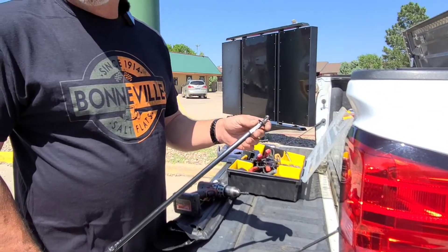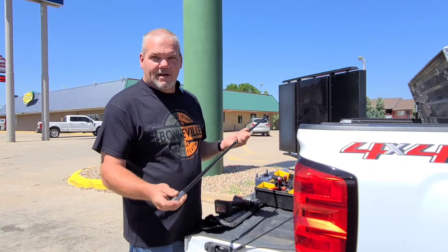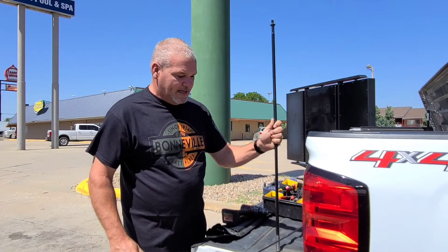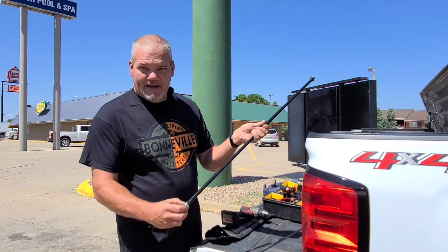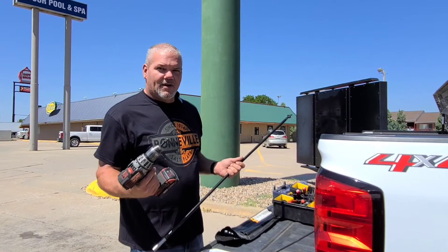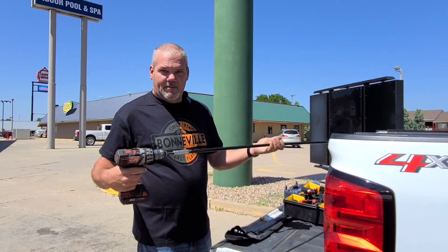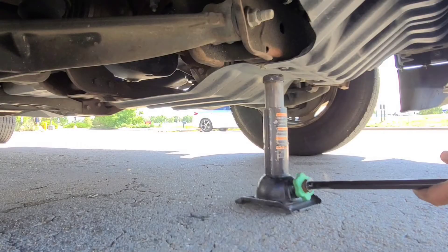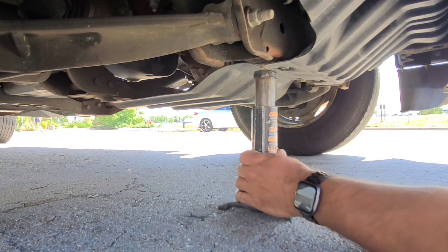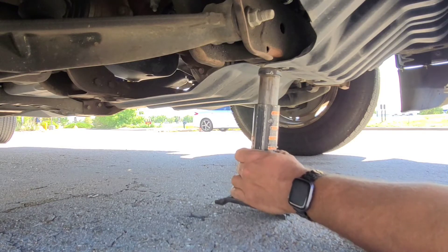I'm going to use the jack to jack it up because it gives you more clearance between the fender well and the tire. If you have one of these on your factory jack, take a 13 millimeter 12-point socket — this one's 3/8 drive — put it up on there and it fits pretty snug. Tap it down until it gets a good bite. You do need a drill in low gear with a 3/8 adapter. You don't want to get under the suspension; you want to make sure you're under the frame, because if you're under the suspension you'll pick the whole truck up.